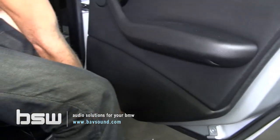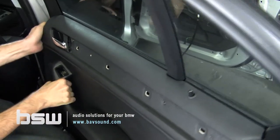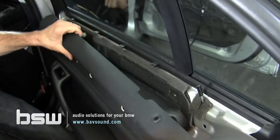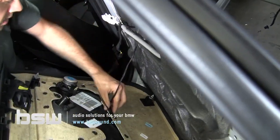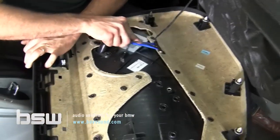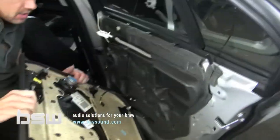Using our hands, working around, then we'll come up to the top. Pop the panel off, disconnect the door panel, unplug the speaker. We'll need our panel removal tool to get this piece loose. Now we'll take our rear door panel up to our clean workspace and finish up the speaker installation.